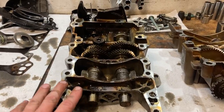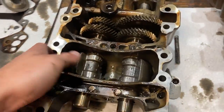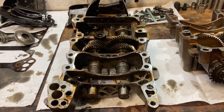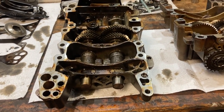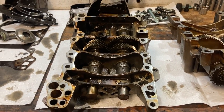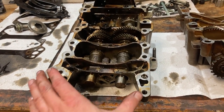Here's how mine failed, and I don't think it's attributed to oil or lack of oil changes because this casing looks pretty clean — I think it really comes down to just a design flaw. When I was driving around at operating temperature from about 800 to about 1900 RPM, I'd lose oil pressure, the red light would come on, and as long as I had the RPM above 2000 everything was fine. After a little while it started to make noise, and using a stethoscope on the engine bracket I could really hear something screaming at the bottom of the engine, which led me to believe it was this assembly.